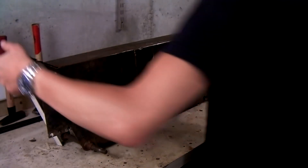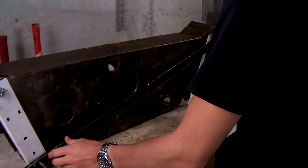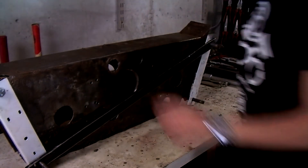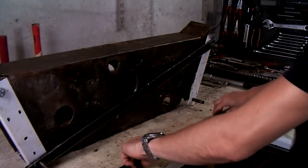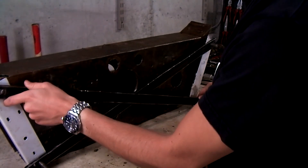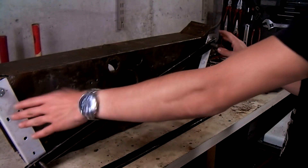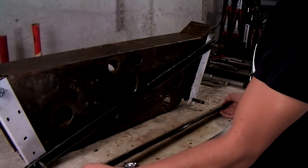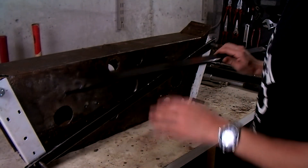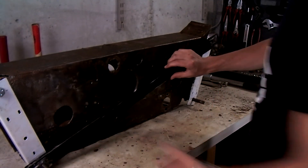I've mapped everything out and made some jigs. These are some of the jigs for the front suspension pickup points. There's another cross brace like this but this front pickup point isn't in the correct position — it's out by a couple of millimeters. When I reassemble everything using this jig I'm sure that all suspension pickup points are in the correct position with very close tolerances. To make this bar I cut some slots in it on both sides and slid it over two suspension pickup points that I know were in the correct position. Then I slid some washers over there and welded the washers over the slots.